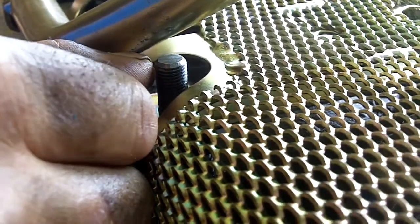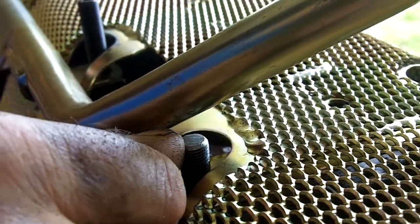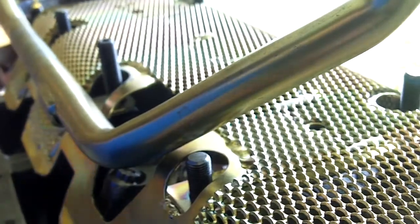And this one here hit the pickup, so you have to cut that. You want some clearance — at least an eighth of an inch. You want these to be able to flex a little; they are going to move a little bit, not much.